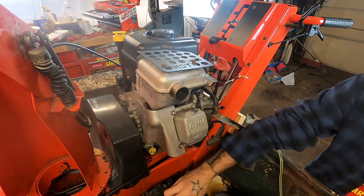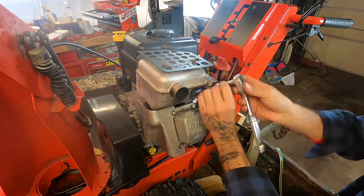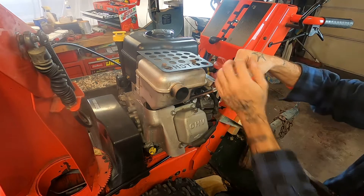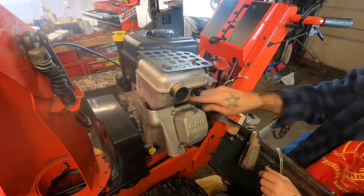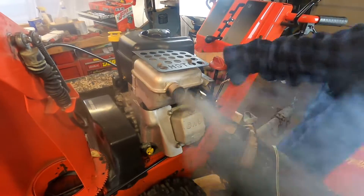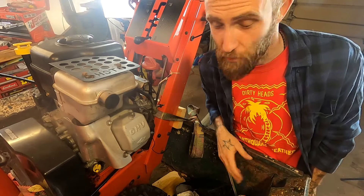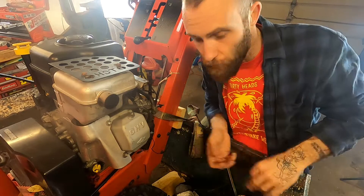If you see the throttle at the bottom, it's off — it just grounds out your ignition at the end of that throw. And that's where I had her sitting. I think we're going to get her this time: we've got a spark plug that's not broken, we've got valves that are going to open, assuming the piston is in one piece and not little pieces banging around in there. A spark plug that sparks and isn't broken in half, and some valves that are open because the rocker arm is attached to the rest of the motor. That's all it took.